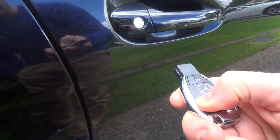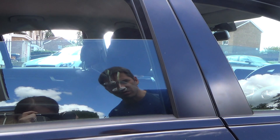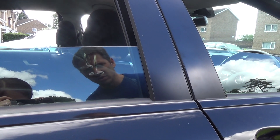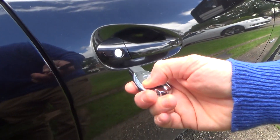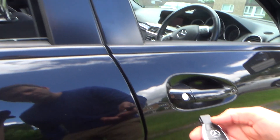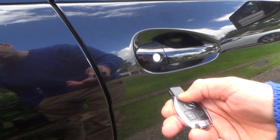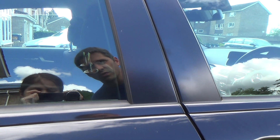To open them, I will hold down the unlock button and then both windows will open, and your sunroof if you have one. You can stop it at any level — you can stop it there — and if you want it to go more, you just press and hold it down and it will go the rest of the way. Then when you are leaving your car, you just press and hold the lock button and it will bring your windows all the way up and also close your sunroof.